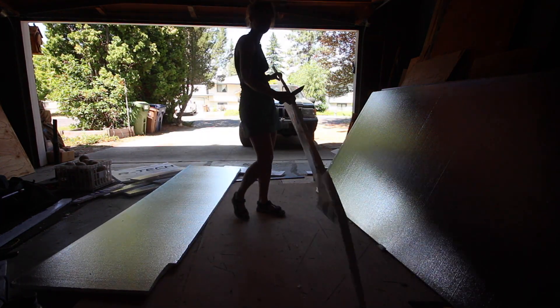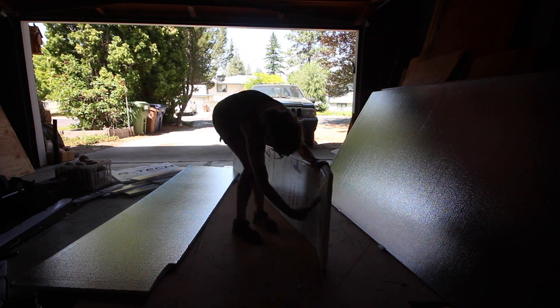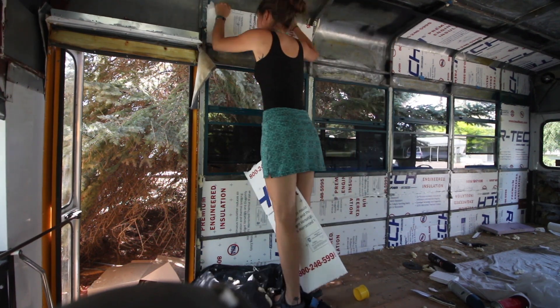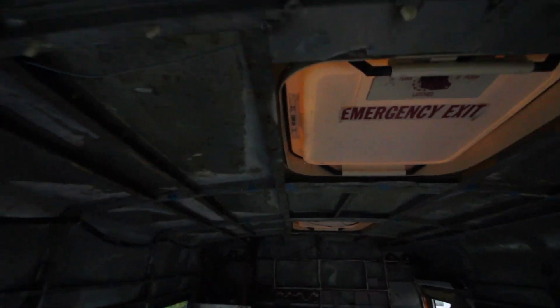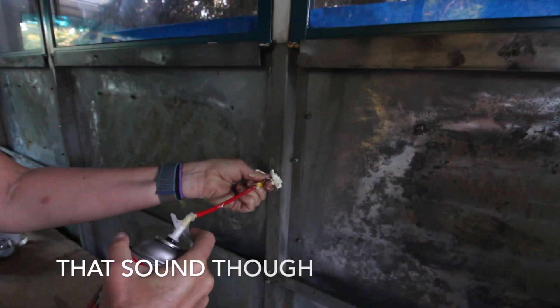I'm going to break the other side because as you can see here, it's a little flappy. This side tends to not want to break. Tell me what we're doing, Mom. We are getting ready to put some insulation in the ribs. The ribs are weak spots for cold to get in and accumulate, so we're spray foaming — finding a hole in the ribs.